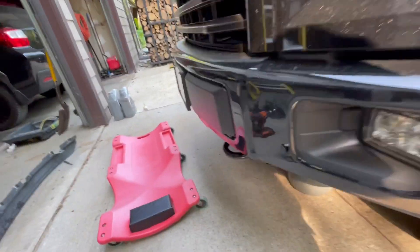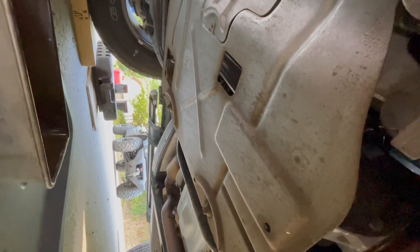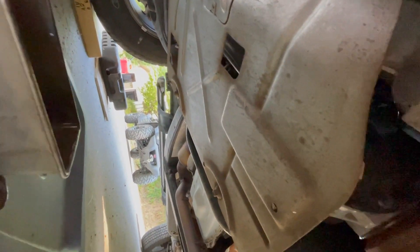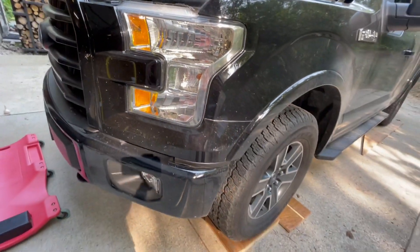But that's what I found — this little hole underneath here. There's a hole right there for the oil to go through. Well, if you're nose down, it doesn't hit that hole — it hits the edge of that hole and dribbles everywhere. So I guess Ford thought maybe you'd have just the front end jacked in the air when you did your oil changes. I have no idea.